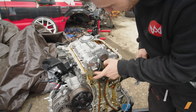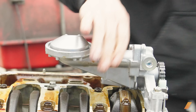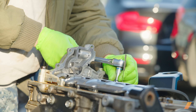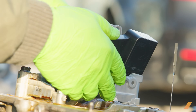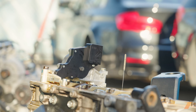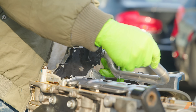In episode one I mentioned we'd get to the manufacturer of this K-Swap kit. He provides in his kit a rear pickup tube because you have to relocate the pickup location from the front to the back of the oil sump — totally normal for these K-Swaps. However, he completely neglected to tell me that you need a specific K-Tune branded adapter to mate this pickup tube. That's why I had to wait an extra week without touching this motor while I waited for that part. Finally the part was installed, the windage tray was back on, and I could get my custom pickup tube into its permanent location before mounting the oil pan.